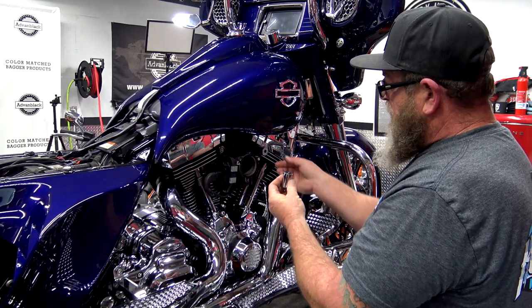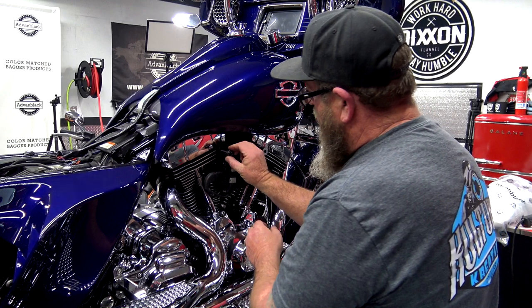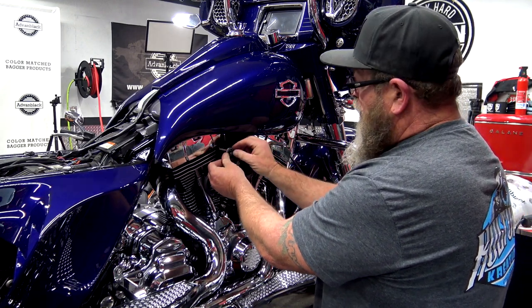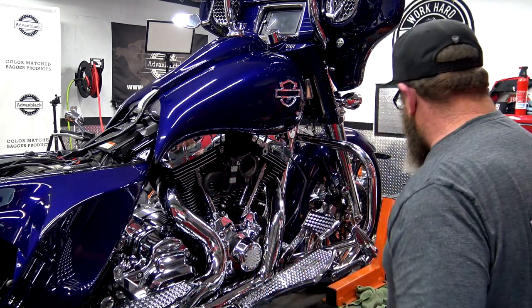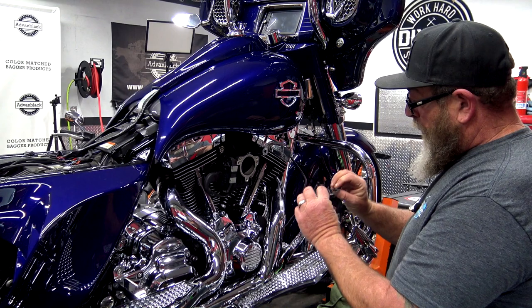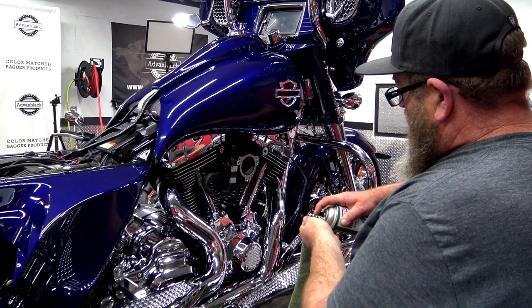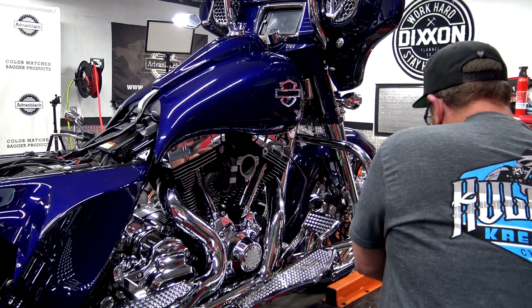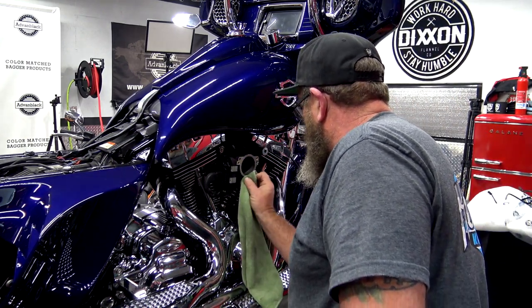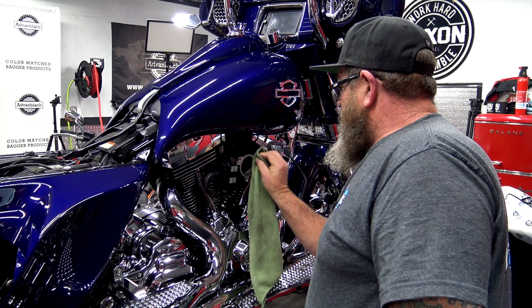What fell is this little spindle right here. That one's still stuck pretty good, but they have rubber O-rings so that when it fits back on there — see that rubber O-ring — it's actually stuck to this but it goes in the backing plate we just took off. So I'm going to gently set that off to the side. Got our little filter here, just came off really nice. There's really not a lot to clean there. I'm going to take some brake cleaner on my towel and go around that in case there's any oil on there.